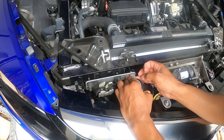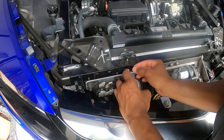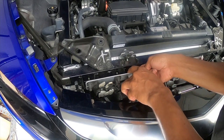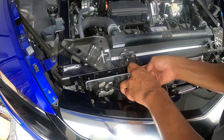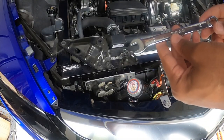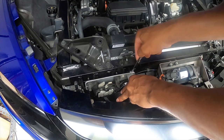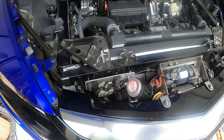And then we're gonna push that through the hole. Okay. Now once that's in there, could be a little shorter, but we'll work with it. And go ahead and we can get that square nut, get that set in place, screw that on, and then the rest is just making sure it's tight in place. All right, so that square nut is a 12. So we go ahead, we just tighten that in place. Sitting good, not rubbing on anything. It kind of sits in an angle, nice and snug. And there you have it. Everything's connected, feeling good. Let's give it a run.